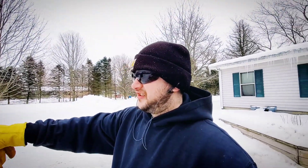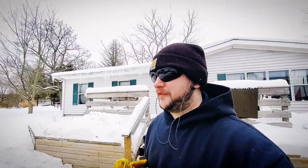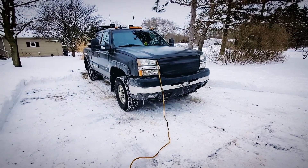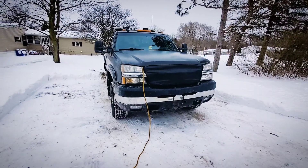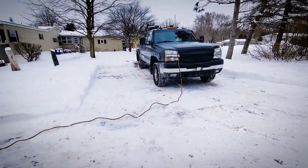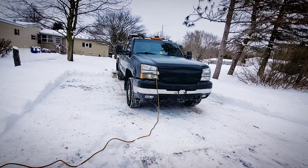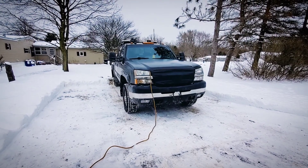This thing — I am so proud of this truck. I know it's ugly to most people. Same thing with my plow — I know it's ugly to people who say, 'Oh dude, you need to get a V-blade, you need to get wings.' I'll say that much — I do see where you V-blade guys are coming from, especially when stacking snow. But I'm so happy with this truck. The whole setup in single-digit temperatures — yes, I keep the thing plugged in, and I keep additive through it to keep it from gelling up, because it's not worth having problems when you got to go out. My barn is heated but it's kind of filled up, so I always make sure it stays plugged in, with additive, and I try to keep the tank as full as possible so when we get temperature fluctuations things don't ice up.